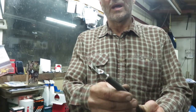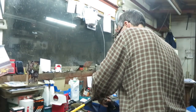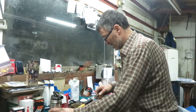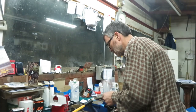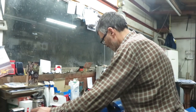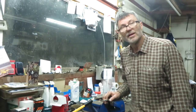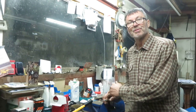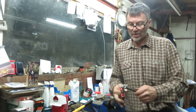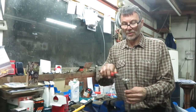I'm now going to proceed to solder that on there. This time, I'm just going to feed in about 2 inches of solder — just enough to set the end without making it rigid. Once the joint is hot enough, it just draws the solder in, and that's nice and corrosion proof now. We'll just put a little bit of petroleum jelly on it. As you can see, I've not put in that much that it's made it inflexible, but just enough to stop any corrosion getting in there.